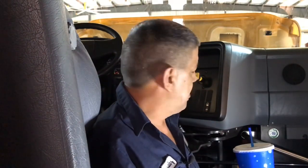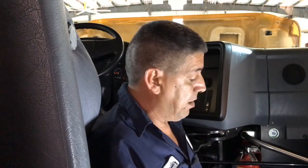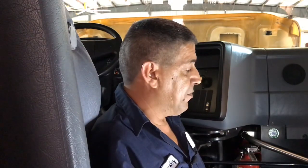It's got a little 90-degree. I think it's a 5/16 little quick connect on the back of the block that is actually losing air, quite rapidly. So this is something we do have to address. We can't let it be. We can't leave it like that because the driver, even though you can drive it, that thing might just pop and cause the air pressure to drop fast.